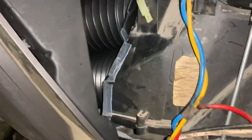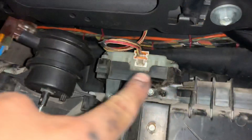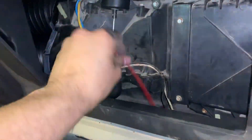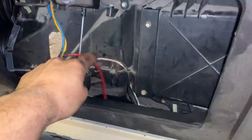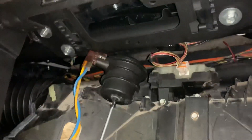Let's take a look at my ducting. My little piece mates up right there — pushing on it pretty good, lined it up well. The air comes through the air box, does its heater magic, then shoots through the tubes over there to the middle part. I just need to fix these little vacuum lines — I gotta extend the red one because since we extended the box, the red one doesn't reach the fitting anymore.